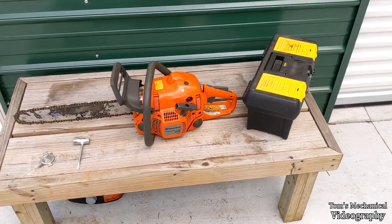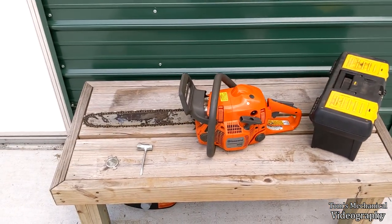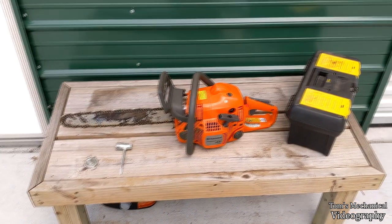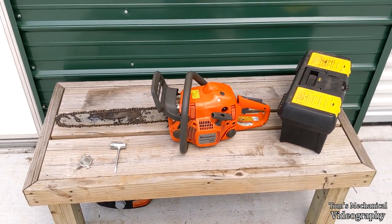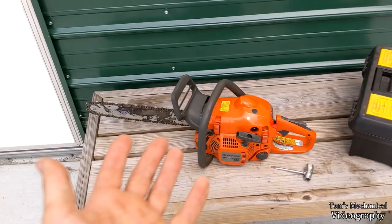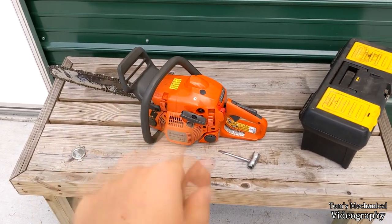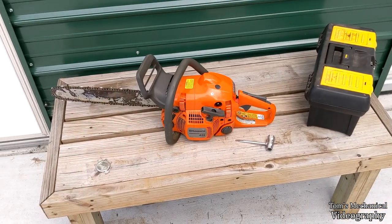I'll check the gap — it's supposed to be 20 thou. I'm probably also gonna do a tune-up on it, just because I bought this thing as a remanufactured unit four years ago and it's seen some moderate use. As a remanufactured saw with four years on it, I probably should replace the air filter, but it looked alright. So spark is first on the list, then maybe fuel filter, although I haven't been putting greasy gas in this. I'm not going to start it right now because I'm pulling the spark plug and I don't want it to be hot.